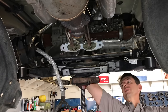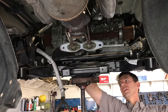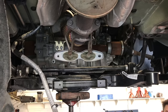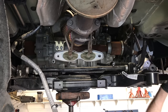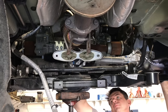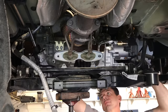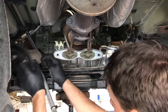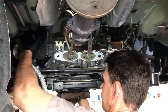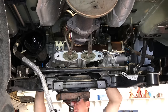I pulled the rubber boot that went around the steering coupler portion of the rack off and set that aside. Now work the rack out towards the passenger side of the vehicle, being careful not to snag anything as you come out. Now take the new rack and feed it back in the exact same way — coming in from the passenger side, twisting and working it around the exhaust and different obstacles as you go through the frame. Once it's in there, twist it back into the upright position. Take the rubber boot that went around the steering coupler portion and reinstall it — you can see how it fits up against the firewall. Press it back into the same position — there are no bolts or clamps, just press it on.